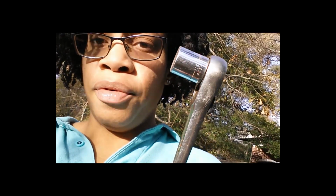Alright, I'm back. So for my car, I need a socket and a 15 millimeter. That's what I need to get the bolt out of the oil pan. So I'm gonna show y'all that. We're gonna go up under the car. I probably should put something on my head to cover my hair, but I shouldn't be down that long. Okay, so hopefully y'all will be able to see this.